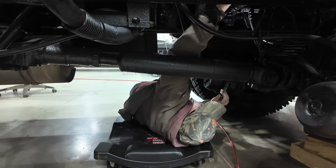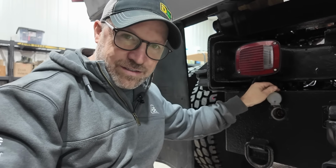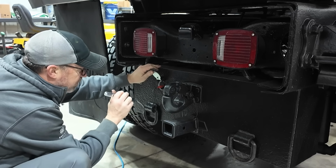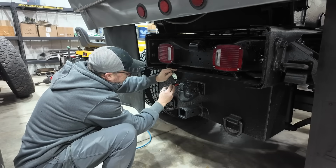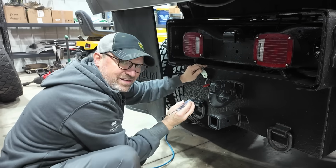So Dad's been over, we've been trying to chase wires. We found if I try to ground to the RV plug and look for power, I get no power there. One of these posts are ground. So I should be able to ground within the plug, and then since I have the clearance lights on, I got nothing inside the plug.